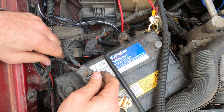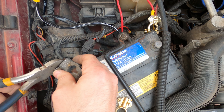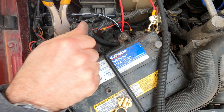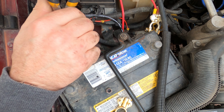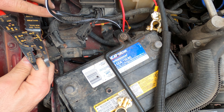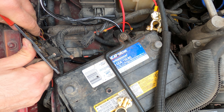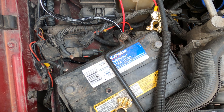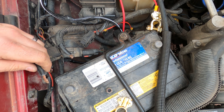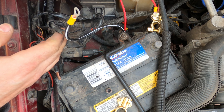The negative has two wires — one goes directly to the chassis ground and the other one goes into the system. I'm going to cut them as close as possible to pigtail, that way I'll have the most usable wire after. This one I can probably remove some insulation with the tool, but I've got to be careful because it's definitely bigger than a number 10 so I don't want to rip or damage any of the strands. Depending on comfort level you can either do this with an actual knife or with pliers. This one's going to be a little bit tougher because of the wire gauge — I'm actually going to go get a knife.